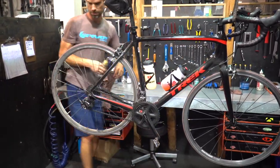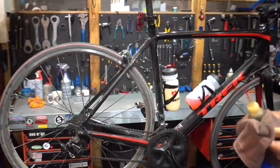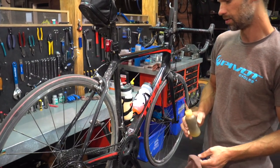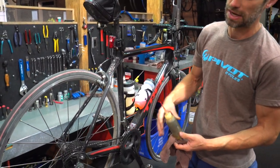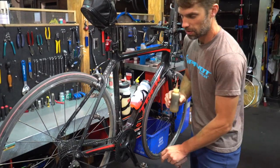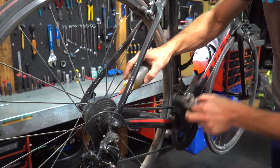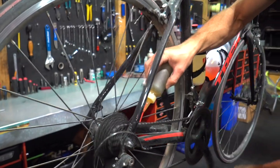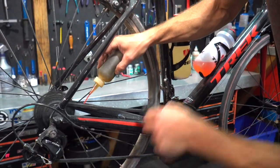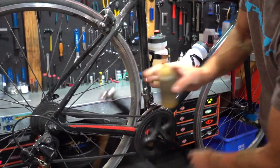So how do you clean it? We'll show you a quick method for taking care of your own bike. When you're done a bigger ride — especially after a wet or rainy ride — you want to have your oil ready. The best time to put oil on is after a ride. You've finished, you've got home, get the bike in the garage, get your oil bottle, start moving the chain backwards and put some oil on the chain. It does not need a lot — just a few seconds' worth. Then keep the chain moving for a minute to work the oil in between the plates.